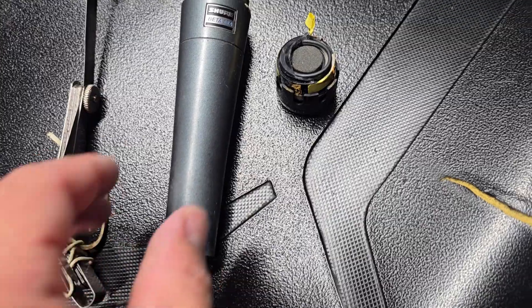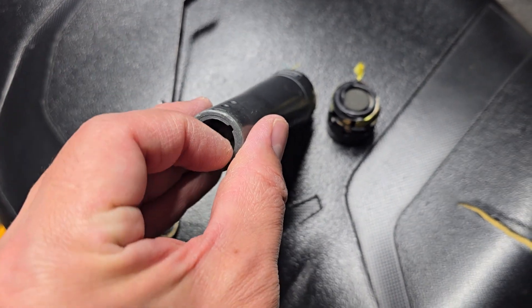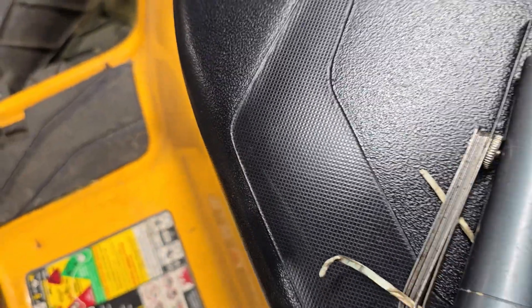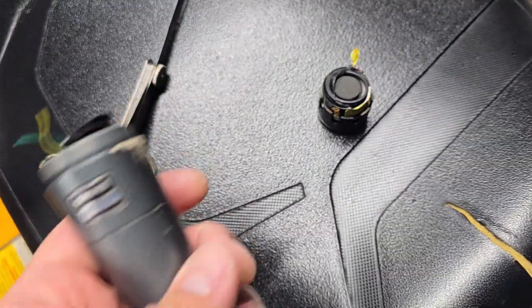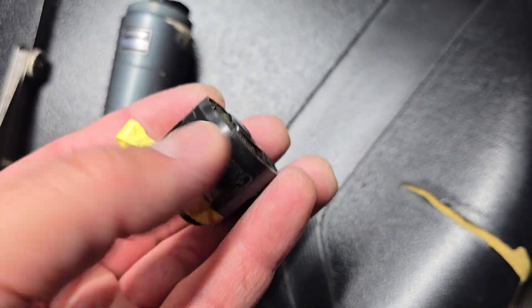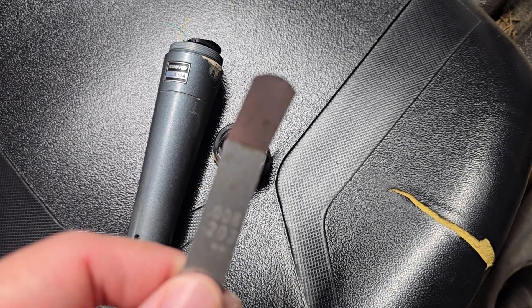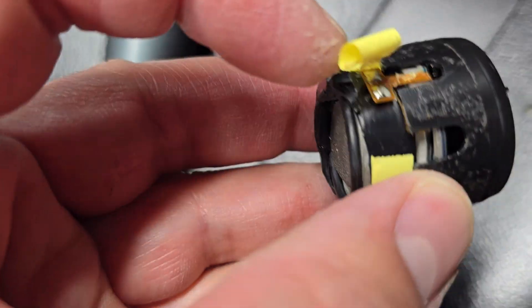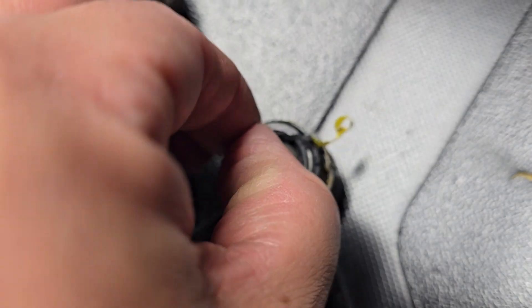If it's not your screw problem — remember this screw is a reverse screw, so clockwise actually loosens and counterclockwise tightens to get this out. All you had to do was: take the grill off, get that piece out, untape the white tape that goes around the outside. I used the spacer — a feeler gauge — my thinnest one to just wedge in there and break the adhesive. That let me pull this piece out. I grabbed onto the plastic piece with pliers and pulled up and out, then unpeeled some yellow tape until I could see the wires.